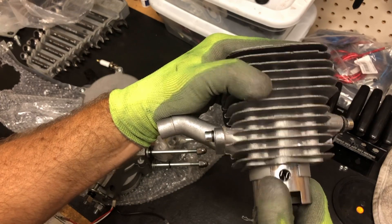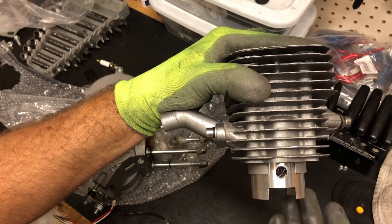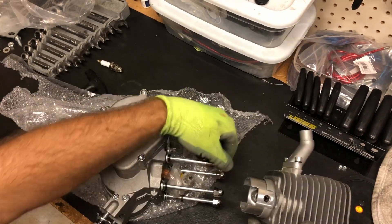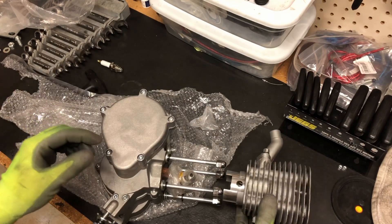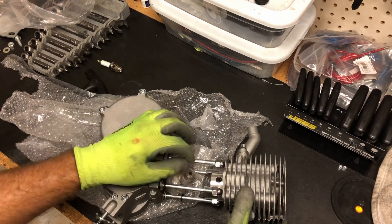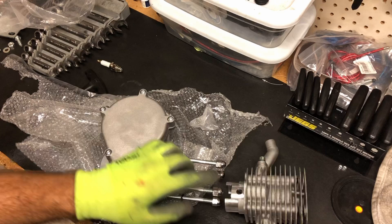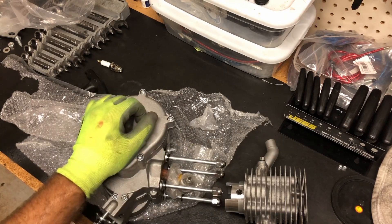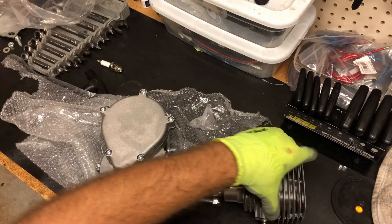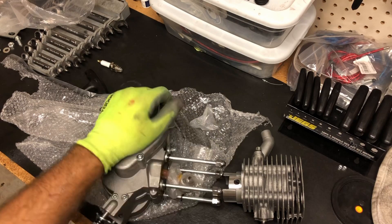So you've verified it by looking at the notches on the bottom of the piston, and also by the pins. Once verified, just slip it back up and twist it clockwise until the hole is centered again. You don't even have to take out your piston — all you have to do is take off your nuts and bolts, pull out your crank, slide that down, pull out your pin as well as your bearing, and slip it all on as one piece. Hopefully that's a quick reference to help you have less chance of breaking those piston rings.